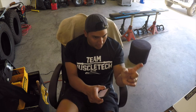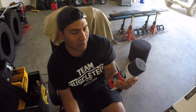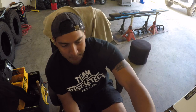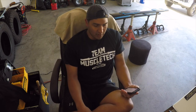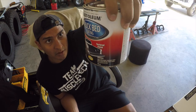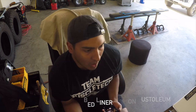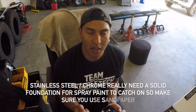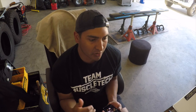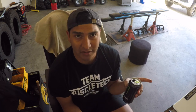After doing some research, you want to go with Rust-Oleum. I'm actually doing this two different ways. If you use spray paint, use Rust-Oleum instead of Dupli-Color — it's been noted on several forums to stick with Rust-Oleum spray. There's also a Rust-Oleum roll-on paint you can buy. The issue with stainless steel is the paint really needs something to grip, so it's easy for the spray to run. I managed to avoid a lot of runs, but when I accidentally dropped it, it chipped — way too easy.